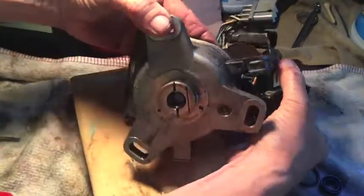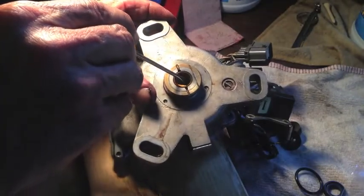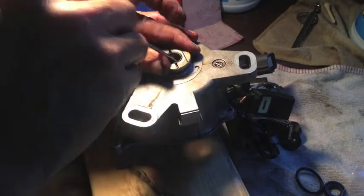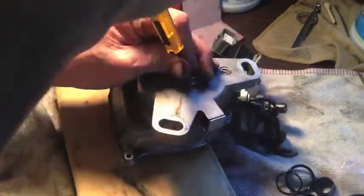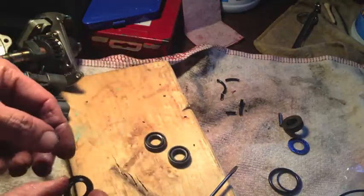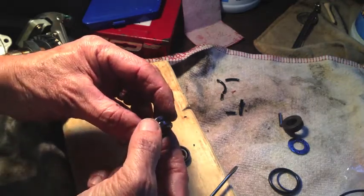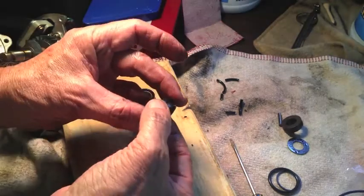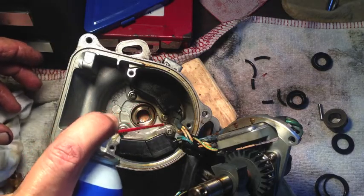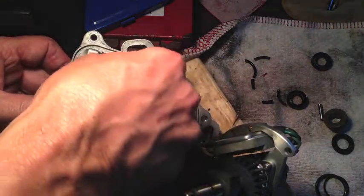To get that seal out, I'm going to flip it over onto this block of wood. Looking down through this hole I can just see the underside of that seal, so I'm going to take a small screwdriver and just bump it with my hand — not too much force. There it is right there. Now here are the new ones, of which I have two. I need to match it in size and it looks like it's going to be that one — they feel like they're exactly the same size. Before I put that new seal down in there, I'm going to spray a little brake cleaner to get it nice and clean where that new seal is going to seat, and also to get rid of some of that oil that had leaked into the distributor.